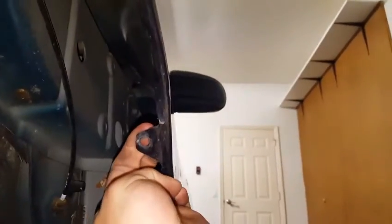Now that we have the fender liner off, it also extends towards the front and you will have another clip right here and a bolt goes right there and one more screw on the bottom. Here's the view with the fender liner off and basically this lip has already been touching on my wheel before so it's not as flared out as it should be. You'll see on the passenger side it is more flared out — this is normally bent out like that in the stock position.